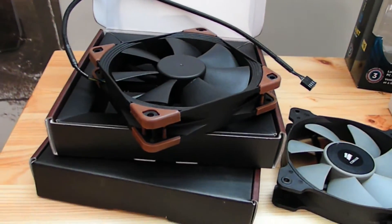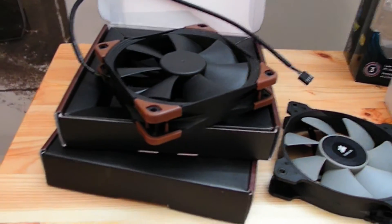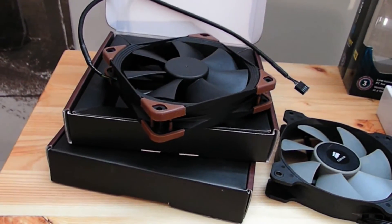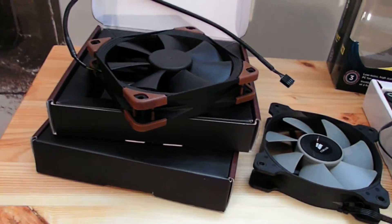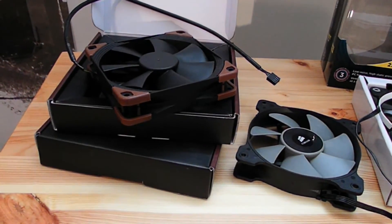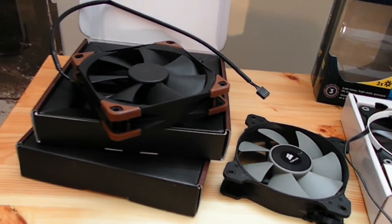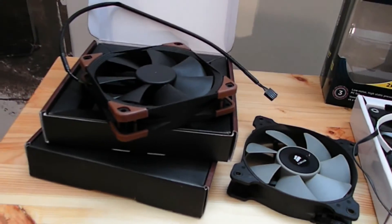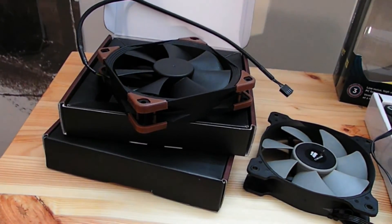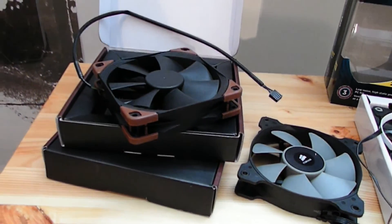People regard this fan as one of the best for static pressure cooling, even though they're not technically designed as an SP version. The Industrial version means they're designed for heavier loads and servers — they have anti-dust technology built in — but they still have the SSO2 bearing technology that the regular NF-F12s have. They also have nice removable rubber anti-vibration grommets. They spin up to 2000 RPM, and that's perfect: I wanted a quiet fan a little faster than 1500 RPM but not as high as 2800, where things get louder than I'd like.